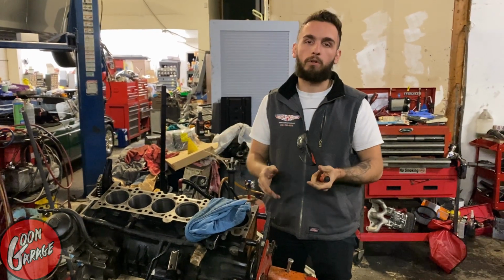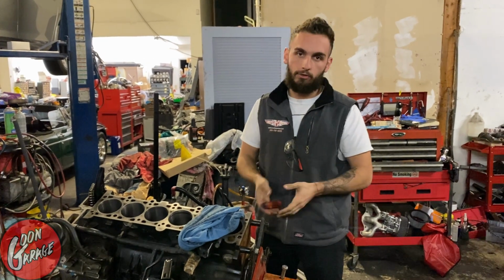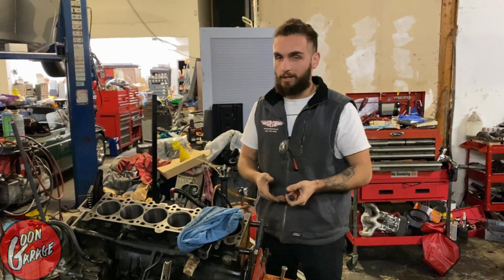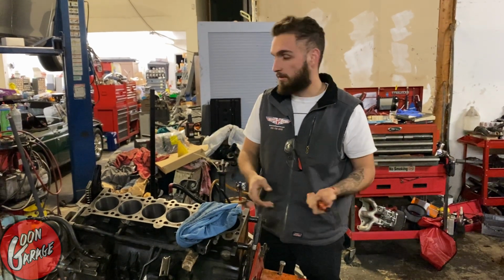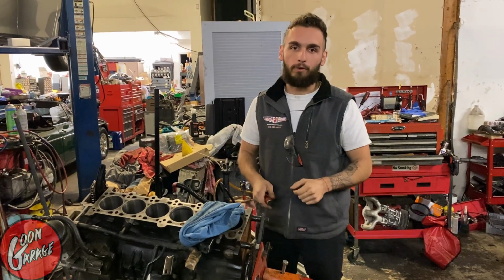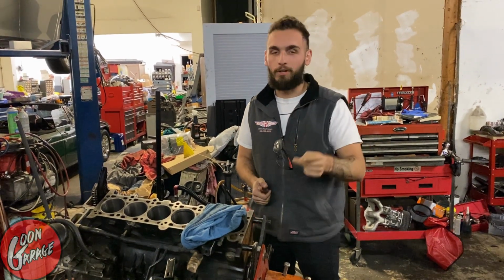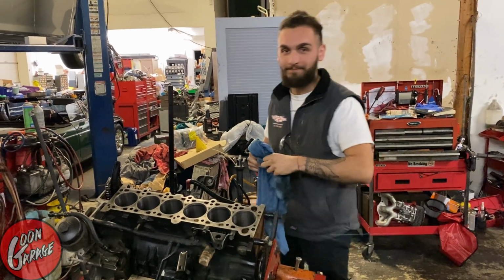So that way we don't have to go and get new bearings and do that whole trick of rebuilding the engine and re-breaking it in. Since we were trying to keep it low buck, we decided to keep and reuse them since they look to be in pretty good condition. So get yourself a set of those. It'll make life a lot easier. Punch them before you throw them in the hot tank, and you should have some pretty nice and clean parts and know exactly how to throw them back in when you're all done. I'm going to get back to it.